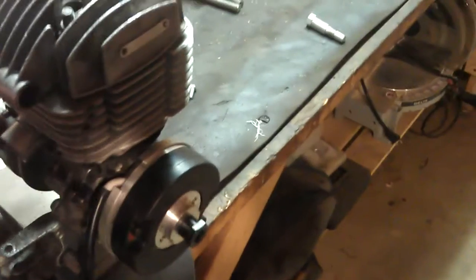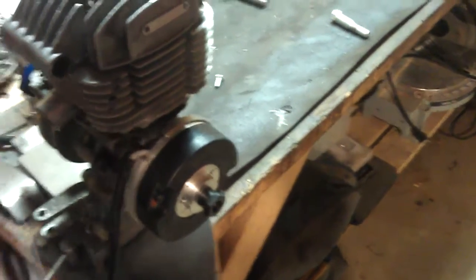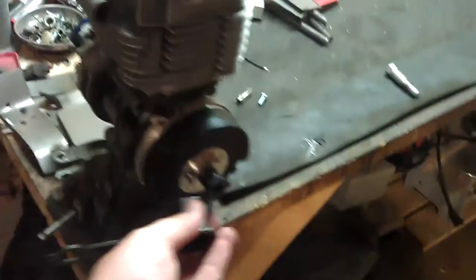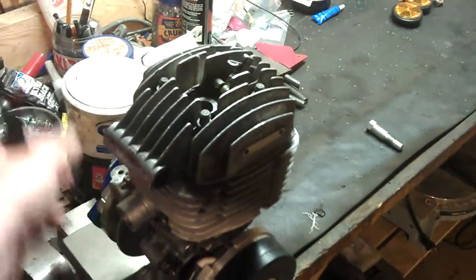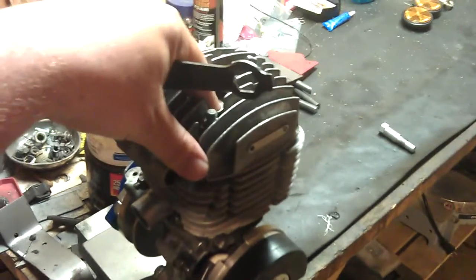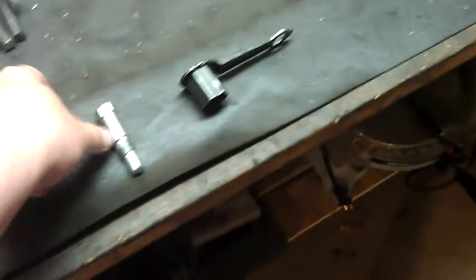There's nothing to resist. If it's on here real good, I can't just hold the other side of the engine and quick-turn it over. So I need something to stick in the spark plug hole to stop the piston from moving — that's where this tool comes into play.